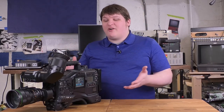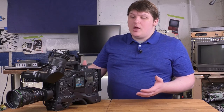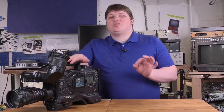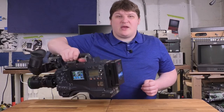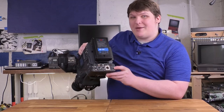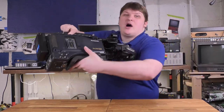As for the camera picture itself, it's a very high quality mid-2000s SD picture. This one can shoot in 16:9 widescreen — not unusual at the time, as there were videotape-based cameras that could also do that. I think the sensor itself is actually 16:9 and when you shoot in 4:3 mode it just crops the edges. You can also record in several different formats: 60 field per second interlaced, 30 frame per second progressive, and 24 frame per second progressive for a film look.